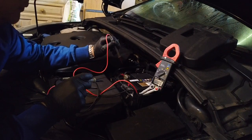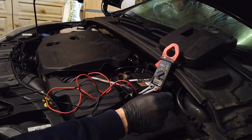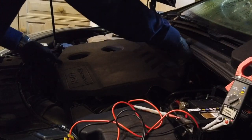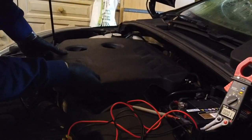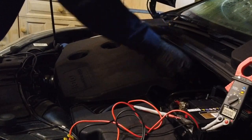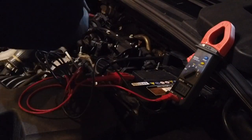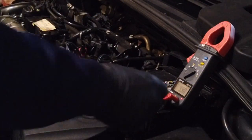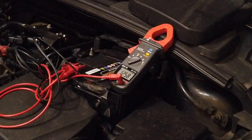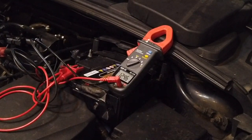Power comes down this wire through a series of connectors under here, which then goes down to the starter motor, so we've got to check that wire out as well. But first we need to make sure that the earth on the engine is good - that's going to be the first port of call. We'll pop the engine cover off, just grab hold of it and give it a tug. We'll click one lead on the positive and one on the engine block on a nice decent earth. We've got 12 volts there. I don't really want to see any more than one volt of drop here.